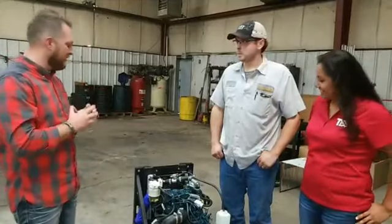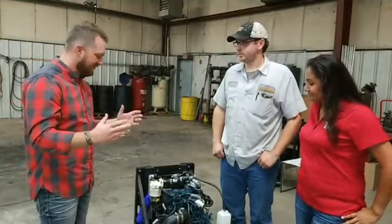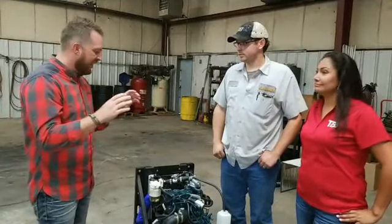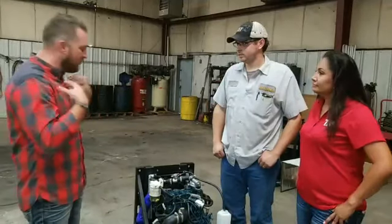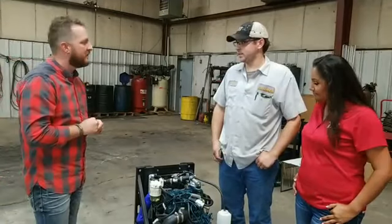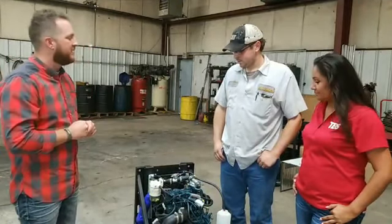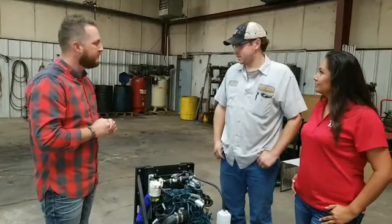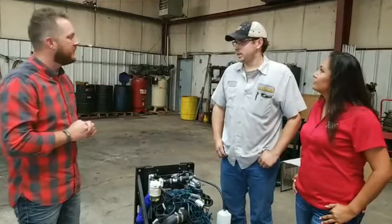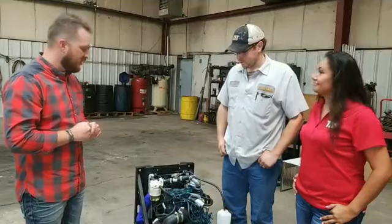So Taylor, I know that when it comes to being a trucker, you don't have to buy an APU. It's an option. But there are anti-idling laws out there throughout the states. If I'm a trucker, why would you say I need to purchase an APU? Fuel savings and wear and tear on your truck. The amount of savings on fuel, and then the things you won't think about, like alternators, compressors on the truck, and the DPF filters and all that you have to do. It all adds up.